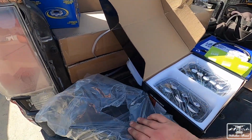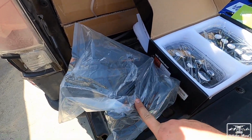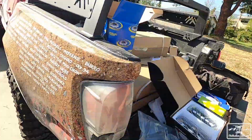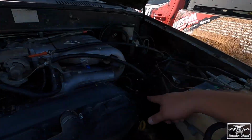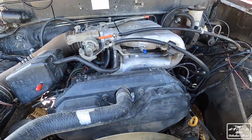And then the other thing that I for sure am going to install sometime this weekend is this transmission mount, because the transmission mount on Winchers, which is the stock one, is shot. It's all cracked, and you can kind of feel it. It looks like the motor shaking, but I think it's the transmission shaking causing the motor to shake, because these motor mounts were good when we installed the truck. So the transmission mount, we'll show you underneath, it's all cracked and beaten up, and we got to get that replaced. So that should be a fairly simple process, but we'll see how that goes.